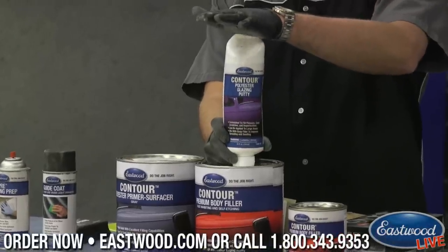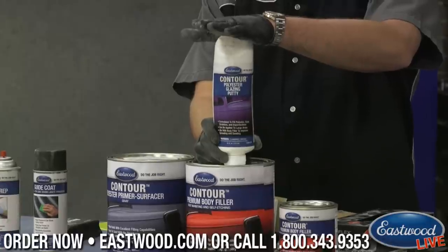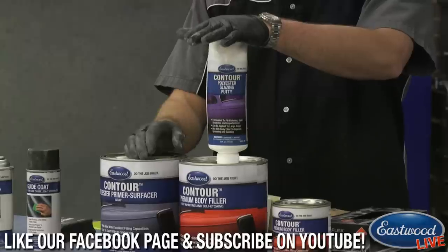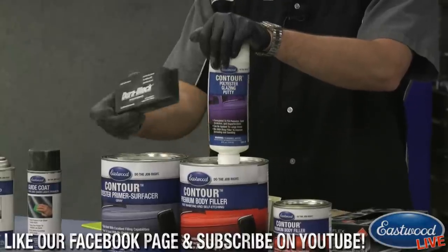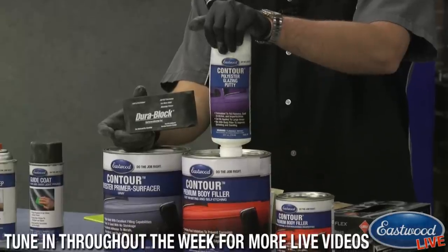Also a really good option if you have just that tiny little door ding. This is perfectly fine to be placed over sanded paint, as long as it's good condition, firm paint. You just have that tiny little dent. A lot of times I like to take some 180 or some 120 on a tiny little block like this and kind of block the area around the tiny little door ding.